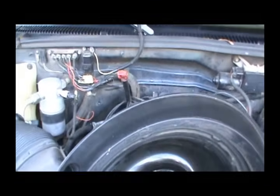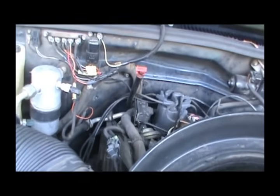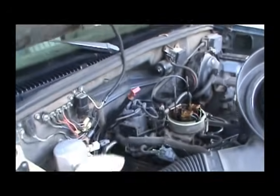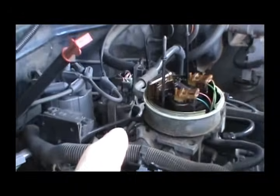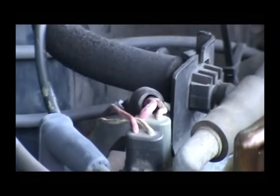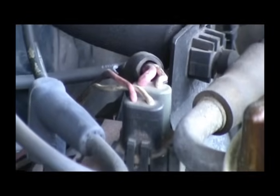Here's the issue with these electronic distributors. You've got an external coil that sits right here, and it's got some plug wires going in. The pink wire right here is power switched — hot all the time when the switch is on. And the white one beside it goes to the tach, if you had a tach, and then it comes out the same colors.